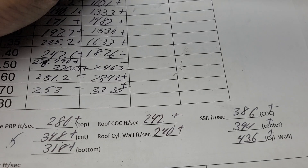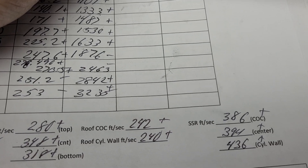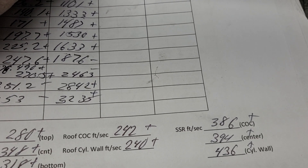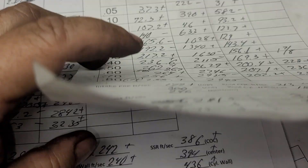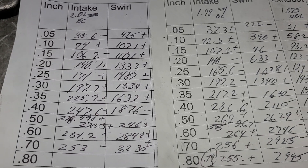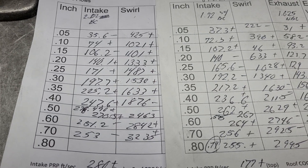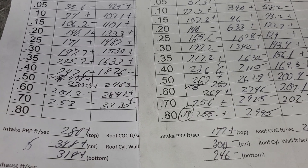The roof turned out really nice — 242, 240 — that's actually better than the Chinese EQs by far. I didn't go as radical to even out the short side on this. I could have moved some air over to the center of the cylinder a little more and made the short side even, but I may wind up losing flow there. 197.7 is not a bad number at 300 — it's fairly decent.